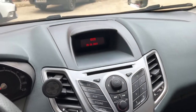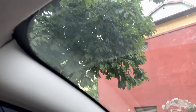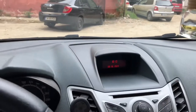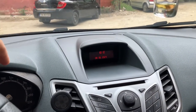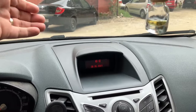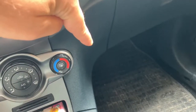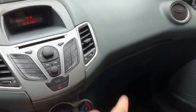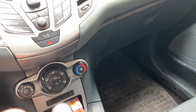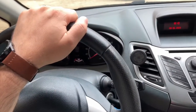I found some hints that the water is accumulating in the cowl area outside of the bonnet. Because I'm always parking the car under a tree, flowers and debris are going inside the cowl, the water is not draining anymore. It accumulates and comes through the air vents inside the dash and then goes into the footwell. In the UK this would be on the driver's side, at your pedals.